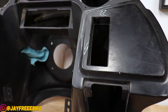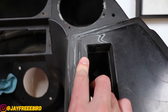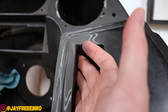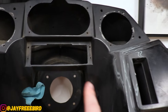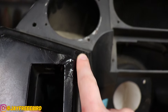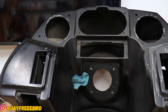So if you're going to repair ABS plastics, this is what I use — this ABS cement. Get it at a hardware store or Amazon for about $7. This stuff does not move. It's been braced back here with the ABS cement. I didn't have an area where I could get more ABS plastic to reinforce it, but that's not going anywhere. Now we're hitting the left-hand side — got a little bit of an edge, so we're going to sand this down, see how it looks. Probably going to have to hit it again to build up another layer. If you're wondering how to fix your ABS plastics with cracks, I highly recommend this stuff.